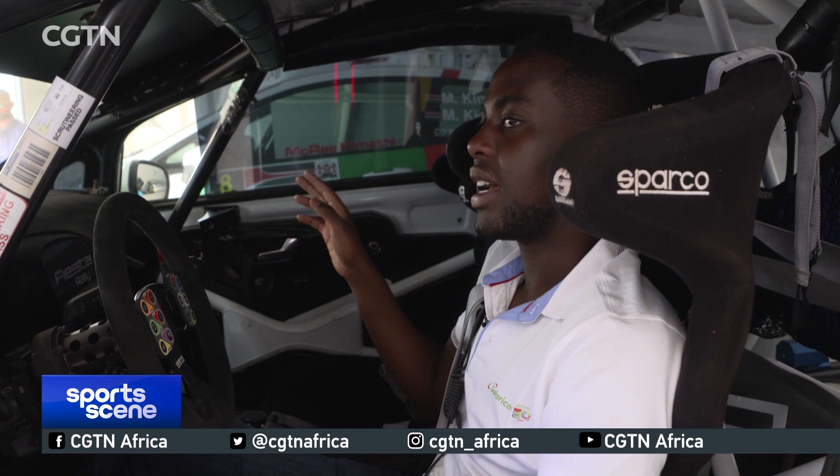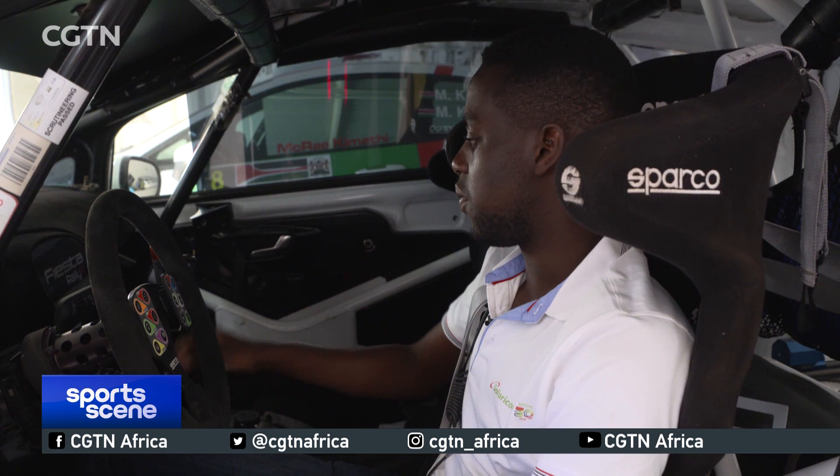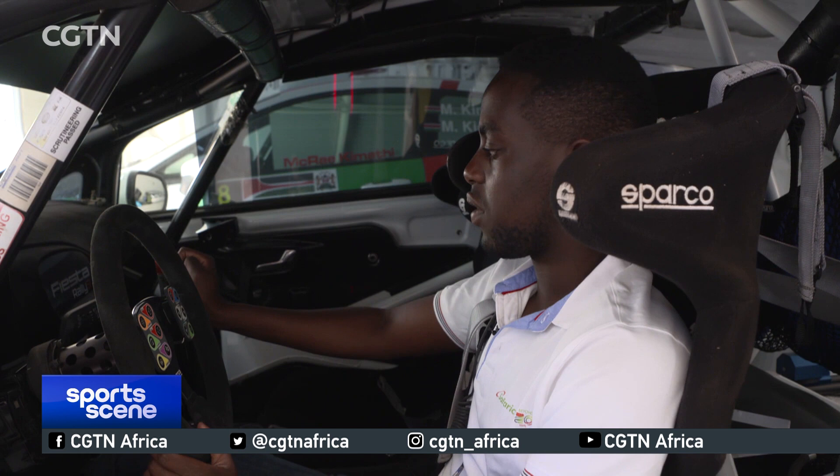The first control is the gear lever. I don't need to use the clutch when shifting — you just pull it and it automatically cuts the throttle and engages the next gear while my foot is still flat on the floor. I pull it towards me to go up through gears one, two, three, four, five. To go down the gears I push it away from me.